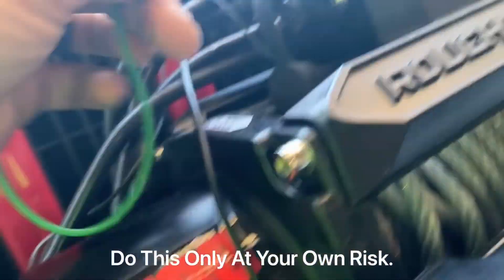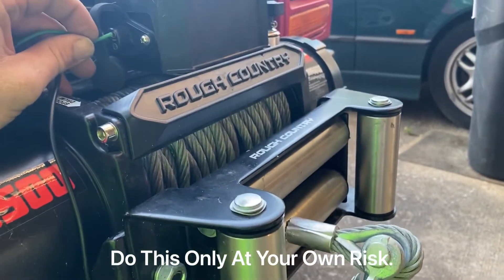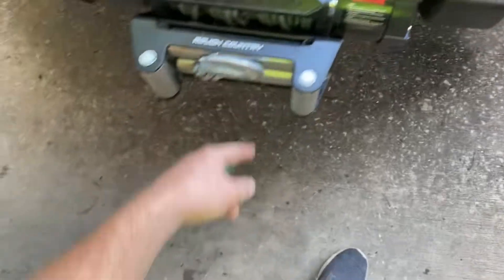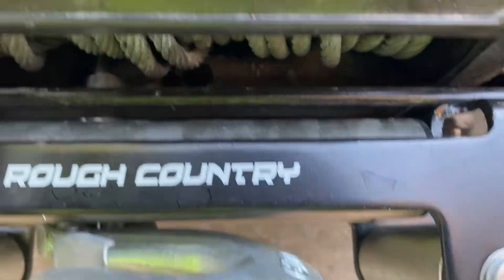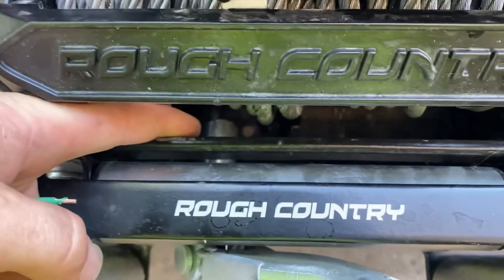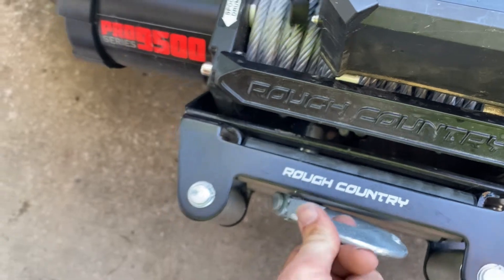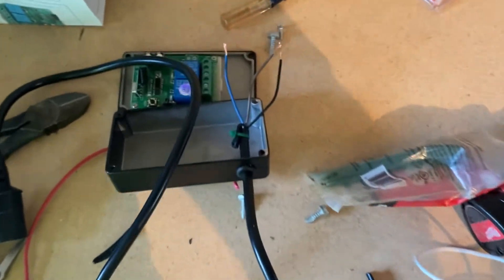Let's start doing this one-handed on the camera. Okay, that's out. The top one of this terminal is in. Okay, we singed her up. I know you're not probably supposed to pull it against the fair lead, but I tried making a D-ring hook for it and it put the collar — that crimp sleeve that ties the wire back to itself after it goes through the loop for the hook — it just binds in there if I attach my hook to a D-ring. So I've got it like that for now. Anyways, now it's time for us to do the wiring inside this.